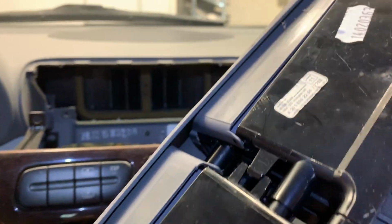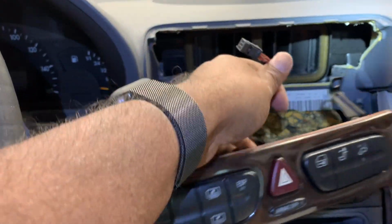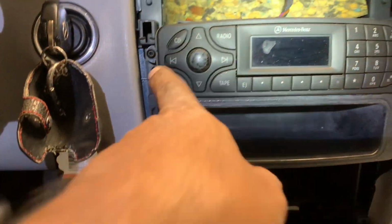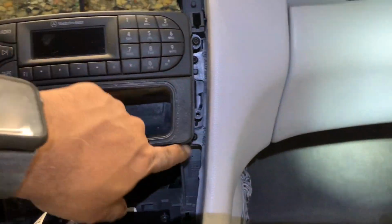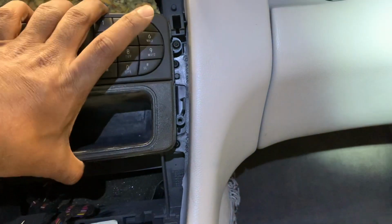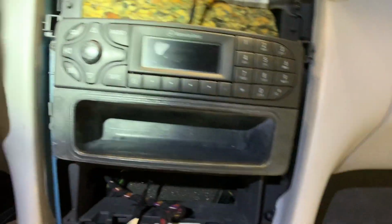So those two screws, so they're off. It's off. Disconnected the power connector. It was a little hard, but I'm not disconnecting the bottom ones. I'm just going to aim down like that. Now I have 4 Torx 15: 1, 2, 3, and the fourth one is not there. Well, it's there at the bottom. So 4, and the unit should come off.